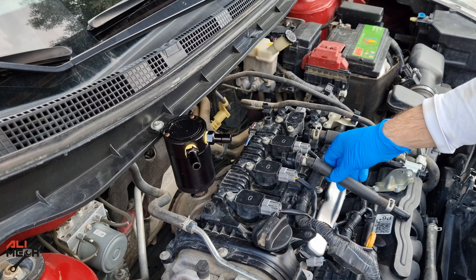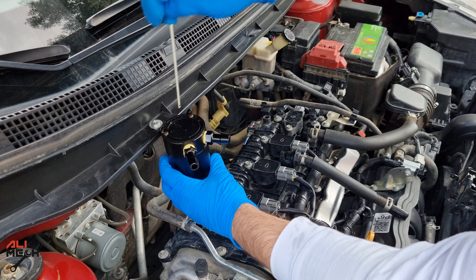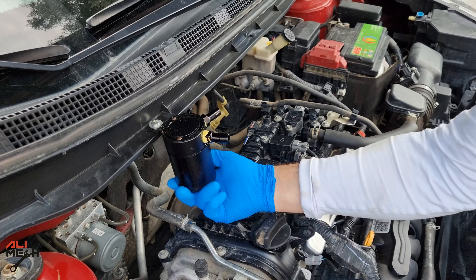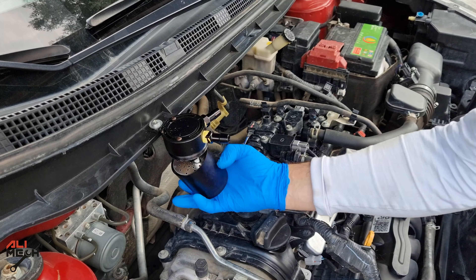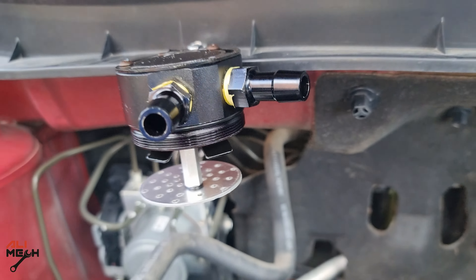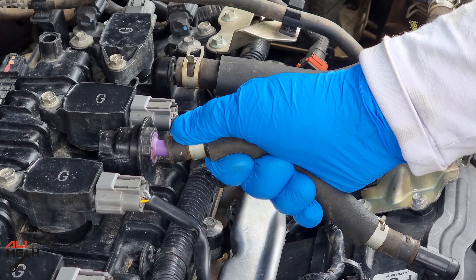It's a very good place away from the engine heat. Now we will need to connect the hoses to the PCV and intake manifold. I will loosen these bolts and twist it so I can have better curves with the hoses — it's way better like this. Let's tighten them up. It's always a great idea to remove the bottom pan so you can see which one is the inlet and the outlet. From the PCV valve it goes here — we can see for the inlet there's only a hole.